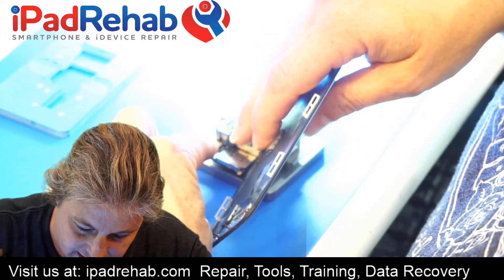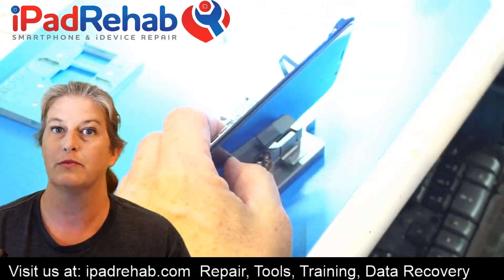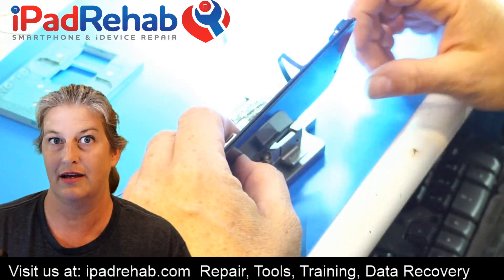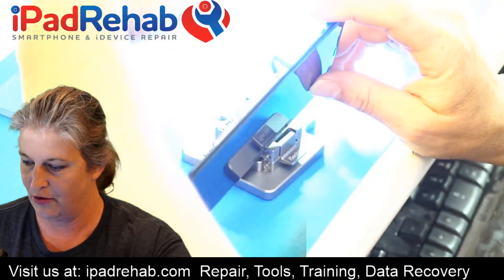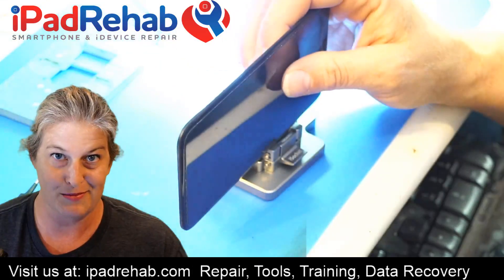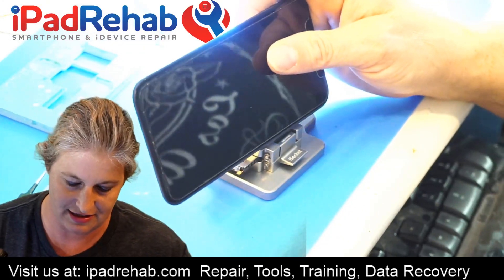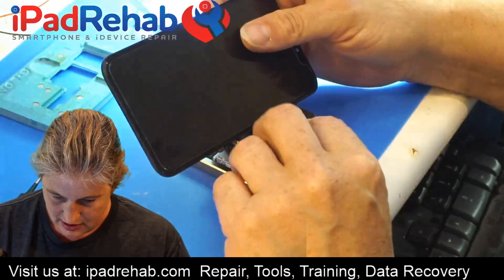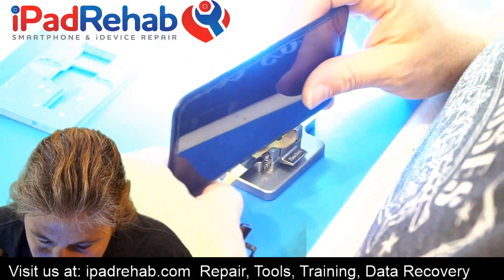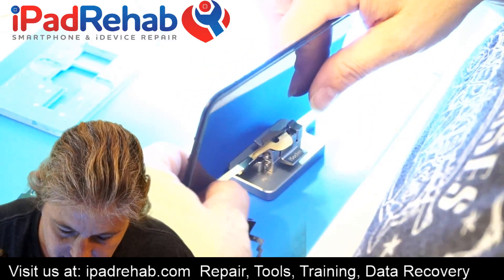Because a lot of times — the iPhone X I was just working on had a VCC main short, but it was in the RF board, not in the main board that has the meat of the phone. So I'm hoping I could put that probably working main board with a different working bottom board. That's the experiment I really want to get to, but I wanted to have some short videos of how to work with the iPhone X, and this one is going to be one of them.